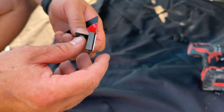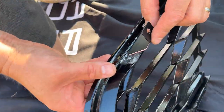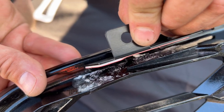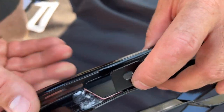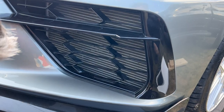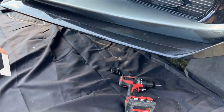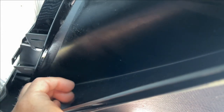This outer tab also abuts another one of the tabs in the back of the bumper skin, so it too can't be misaligned. This is a notch that's in the mold for the OEM part — our part simply drops into that notch, so you can't get it in the wrong spot. The other one butts right up against a bumper tab. You literally cannot put these in the wrong spot — it will guide you right into the right area. After you take off that tape backing, it sticks right on there, and then your last two tabs are done, which will ultimately hold that grille onto the back.